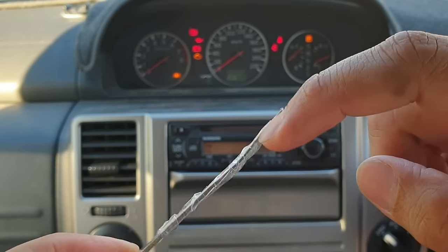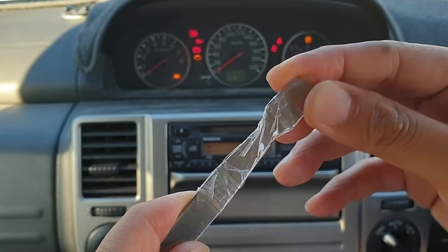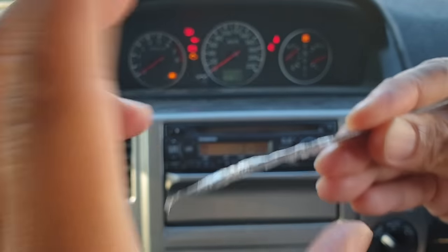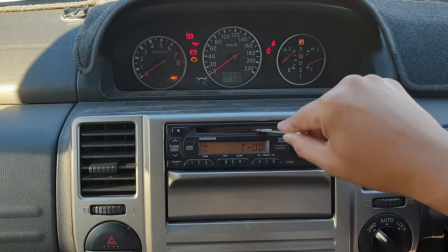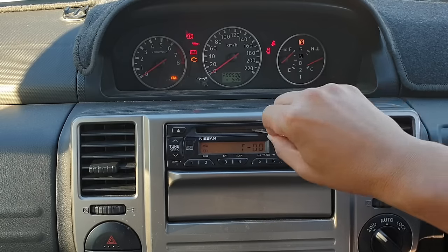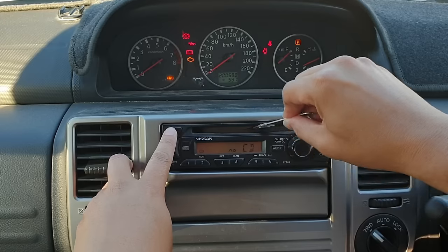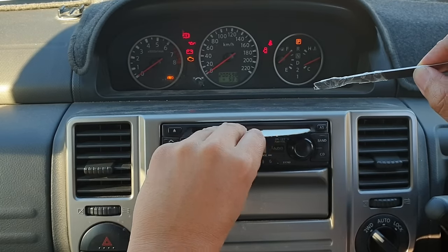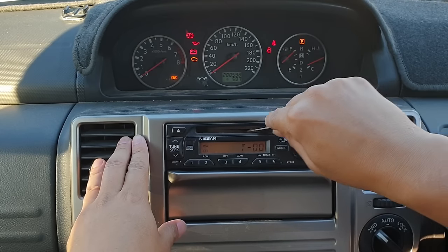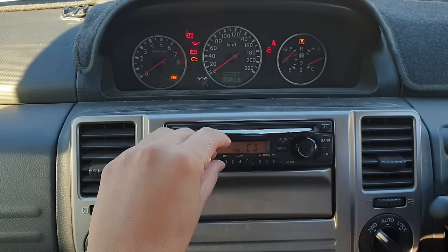I've put sticky tape on the tool — just tape it once, then twist it around, and we'll see how we can pull out the CD. Make sure the sticky side is facing outward. Push it in and wiggle it around. Once you put it in, the CD player may start to wind or make some noise — keep wiggling. While wiggling, also press the eject button at the same time, as that helps the CD come out. Wiggle it, push it up and down, and eject at the same time to help get the CD out of place.